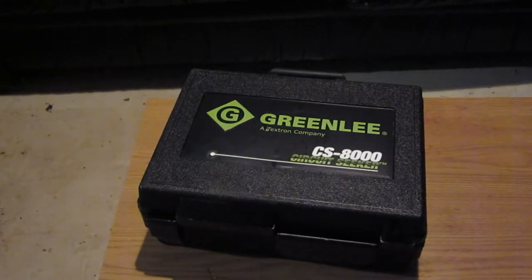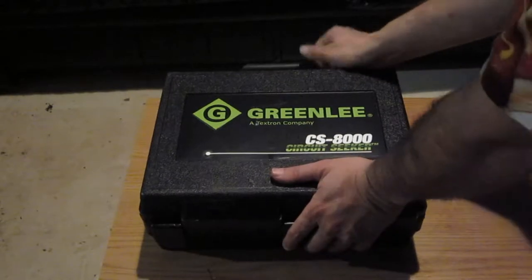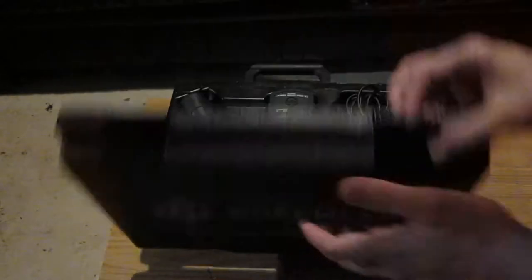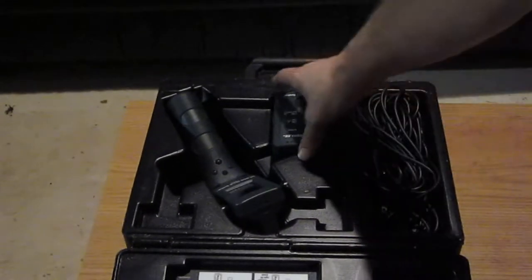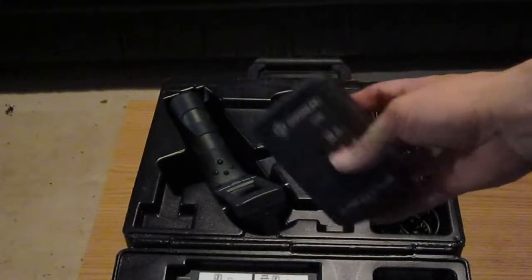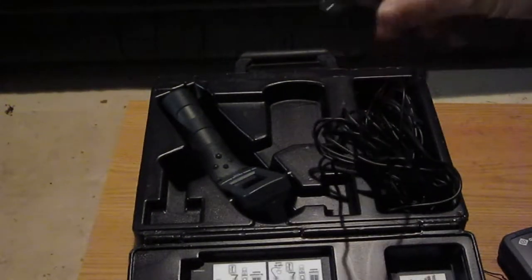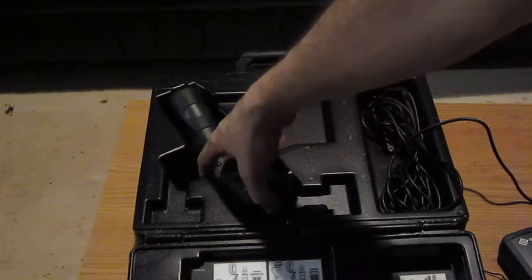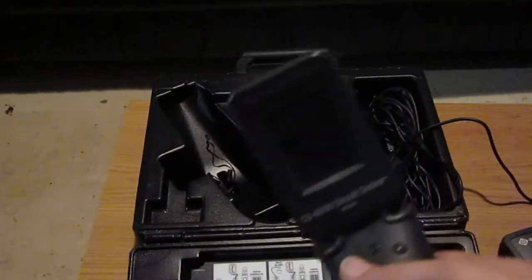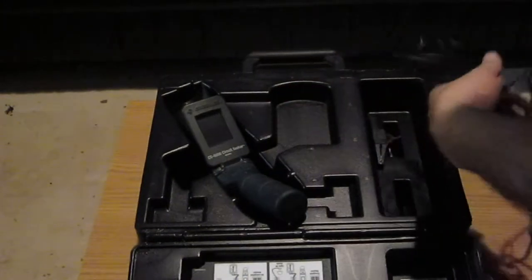We're still having problems with tracing the wires in our car, and here's a neat little device that I happen to have at the moment. It is a circuit tracer, and it's composed of a thing that generates RF signals here. You're supposed to use it with the wall — it's got a wall plug, and you can send RF signals through your walls, and then you have a little thing to detect it. But it should work, I think, with our automotive wiring.